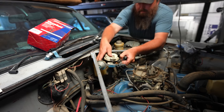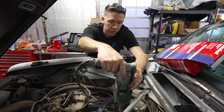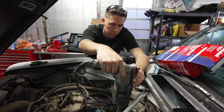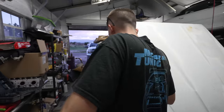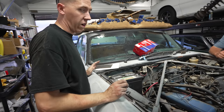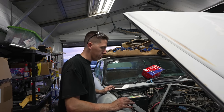Small block Chevys - learning new things, carburetors, distributors. Don't let it go anywhere. I started already - just a few turns and it felt like it got a little bit of tension, so I think that's when it primed the pump. Now just letting it ride real easy, maybe do this for a minute or two. The battery just got done charging - took about the perfect amount of time. Set this thing in here. Hopefully when we go to hook it up we don't get any big sparks. We should probably find a little fire extinguisher just in case before we get too much electrical going on.